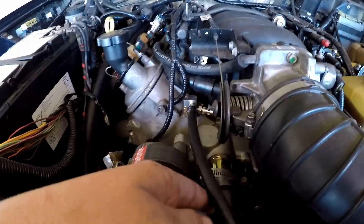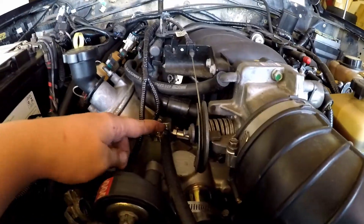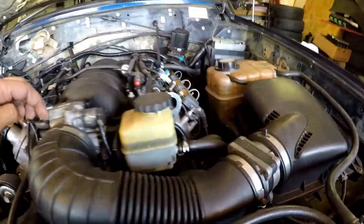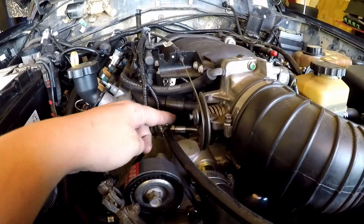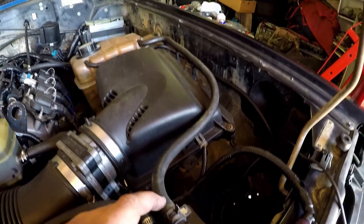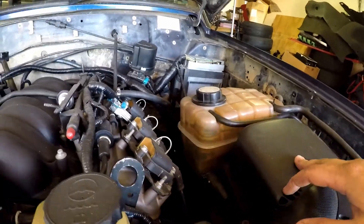And then we have here the line for the steam port. Normally I think it goes into the throttle body — in on this side in factory — and that comes out this front fitting down here. But I got rid of that. It's just a one crossover, and then it has an outlet on this side. So it just runs in to the top where it normally would run. And then this is the overflow back to the bottle, and then this is the actual overflow when it goes over pressure. So that's how I can fill the system now — that was an issue that I had.